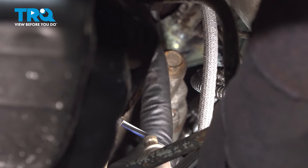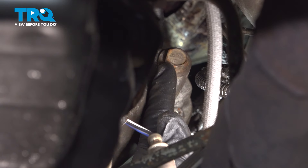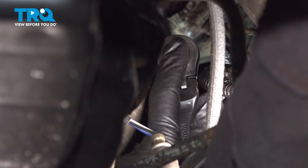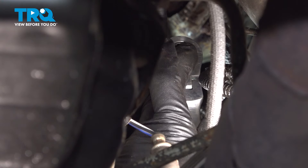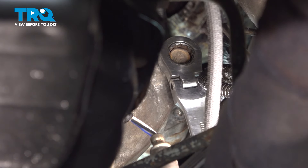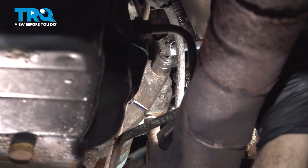I'm going to access the rearward bolt — it's on the backside of the bell housing going forward into the starter — using our 15mm gear wrench. You can use a super long extension in your impact gun if you want to. We're going to switch over to our extension now that we have that bolt broken loose, using our 15mm socket and extension.